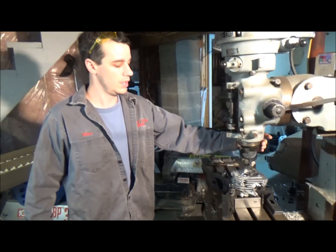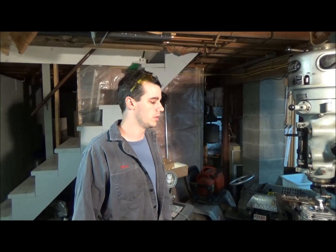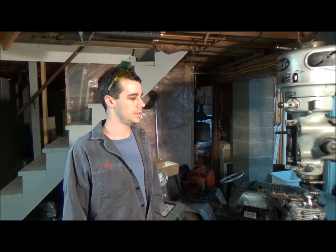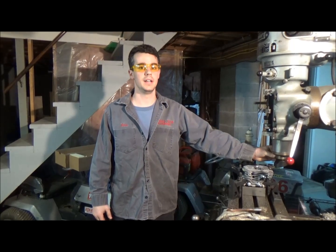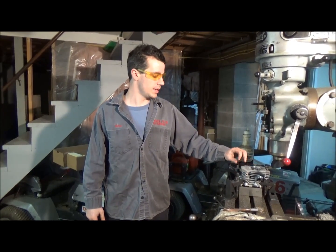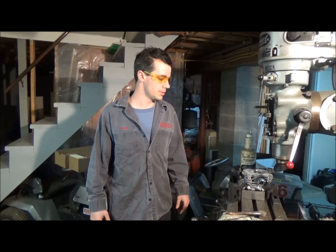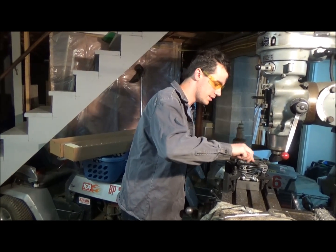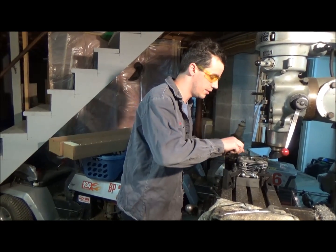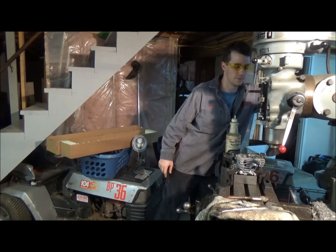This head I'm planning on taking off about 25 thousandths — maybe I'll go a little more, maybe 26 or 27 thousandths. That should get us right around a 10.5 to 1 compression ratio. I already did an initial pass and took off ten thousandths just to see how it seemed to cut — it did a pretty good job with just a basic fly cutter; it's only aluminum so it goes nice and slow. I'm going to put a little more cutting oil on, I've already moved it up another ten thousandths, so this cut will get us down to twenty thousandths off, and then I'll probably do a five thousandths finishing pass after that.